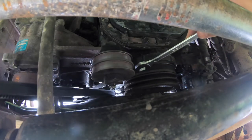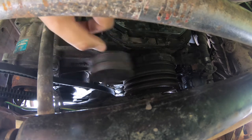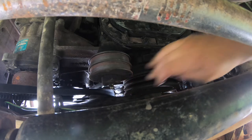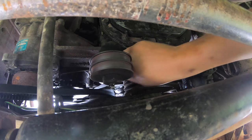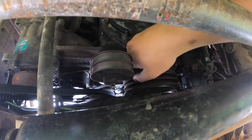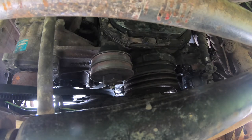I think I got the belt off that section — the other belts can stay for now. Before going for the grease gun, I need to derail the belt from the top alternator pulley, which means getting up again, then lying back down and getting dizzy again. I'm fairly confident I have the same size belt — this is a 15A 1205, exactly matching what I have — so cutting it off is potentially an option, but I still need to learn how to pass a belt through here.